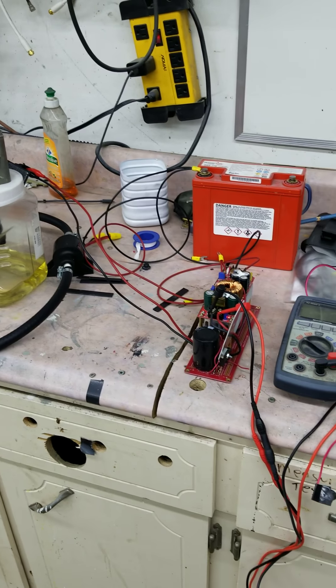This is a fuel injector tester designed to activate 12-volt car injectors — it will not activate an ETEC. So I feed this system, which amplifies the pulses from a standard fuel injector tester up to 55-volt pulses to activate this fuel injector.